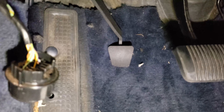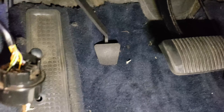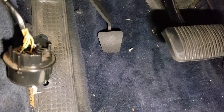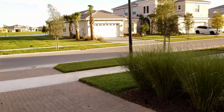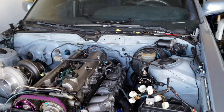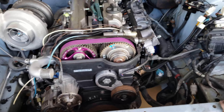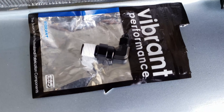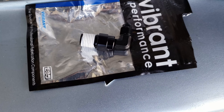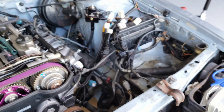Right now I'm messing with this clutch pedal that's breaking my back. I think I'm going to end it here for tonight. Another beautiful day here in Florida — something like 65, 70 degrees. I don't feel like laying in the foot well trying to install the clutch pedal right now. So I'm going to start buttoning up stuff in the engine bay that I can. Also I found the quarter MPT 90-degree swivel to dash-4 fitting I was looking for to put on top of the turbo. Since I'm working on this side of the car, I'm going to go ahead and permanently bolt everything down on the exhaust side.